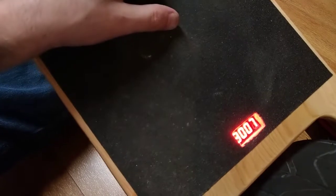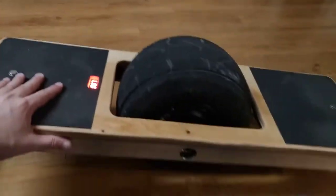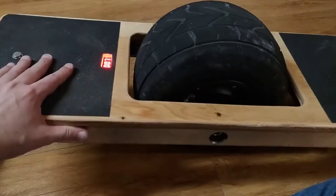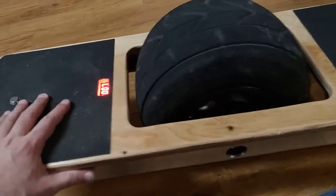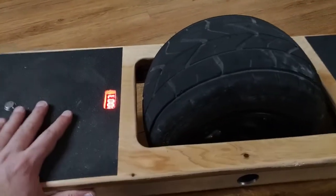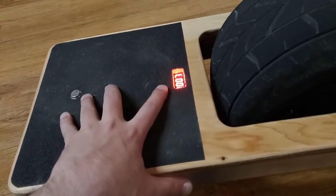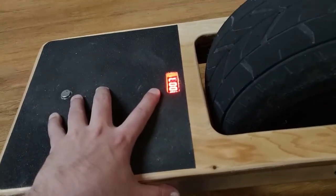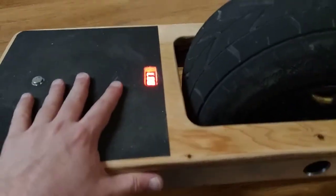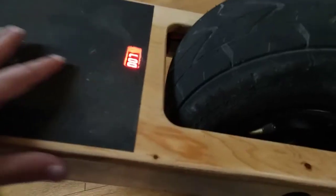The third setting is your center zone, measured in degrees. Everything from 7 degrees to minus 7 degrees is basically your float mode. This is really going to matter when it comes to the overdrive setting. For now, just remember I have this set to 7 degrees as my center zone.